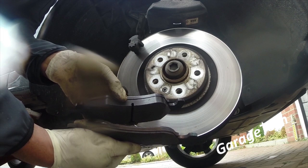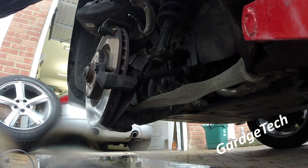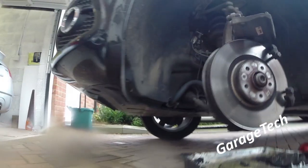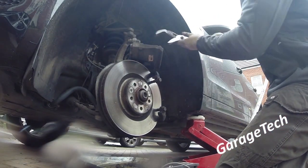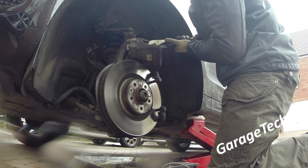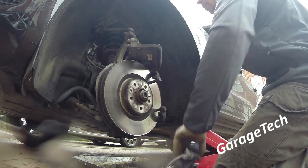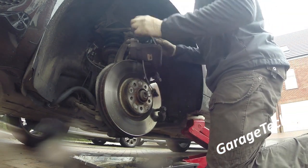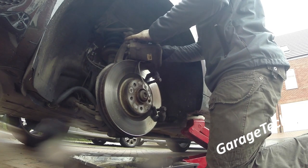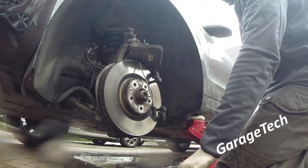Here's a quick picture of what the pads look like before and after — there's actually quite a bit of wear on the old pads, not much left on them. With the new pads it's simple: pop them back in place, always start with the piston side first. Just be careful you don't damage any of the pins. I'm using my grips to push the piston back that little bit more — push it back as far as it will go to allow for the new pad material. Put the wiring loom through the middle of the caliper and it will just clip into place.